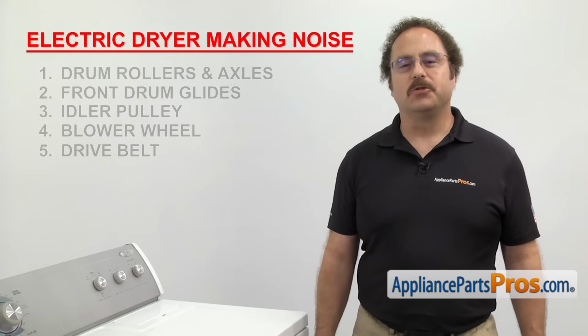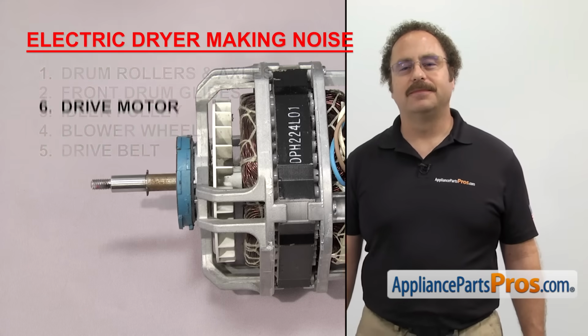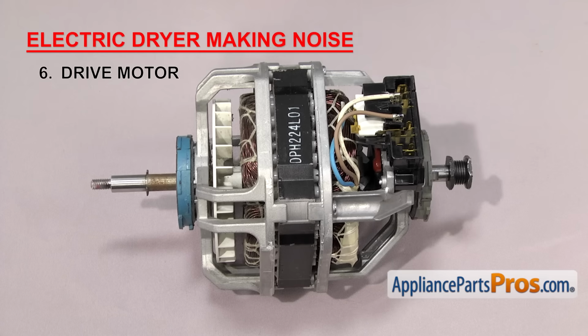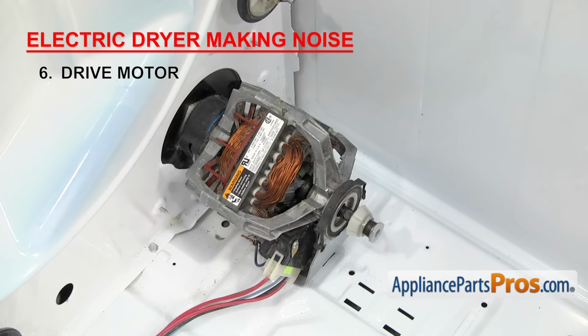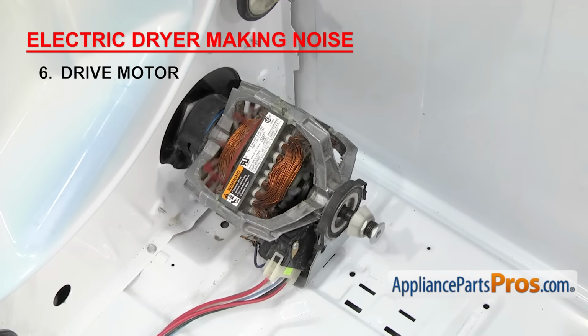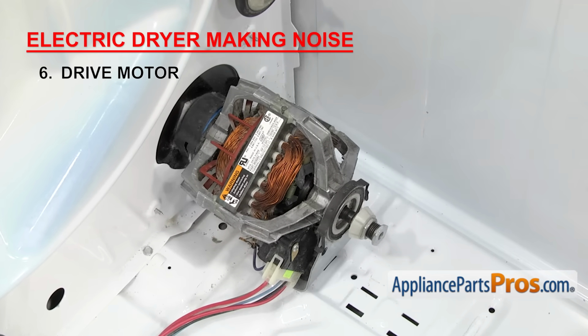Last thing we're going to check is the drive motor. It drives the dryer drum and the blower wheel. Inside the motor are a couple of bearings. If they fail, you'll hear a squealing noise when the motor is running. Once you get to the motor, you can manually turn it. It should spin freely. If there's any unusual friction or you hear any noise, you'll have to replace it.